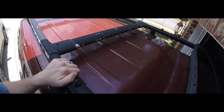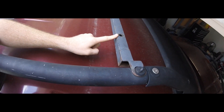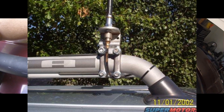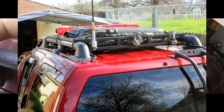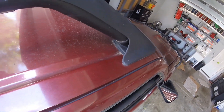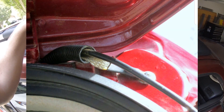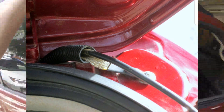If you have a steel roof rack, a roof cage, or in my case a steel light bar, you could weld a tab and mount an antenna up there. But you still have to figure out how to get a good ground because the mount doesn't go directly through the sheet metal. The coax would run up there and ground through the light bar, but the rails are mounted with rubber gaskets for weatherproofing, which doesn't give a good electrical connection to the roof. You might have to run a ground strap and solder or bolt it to the actual roof.